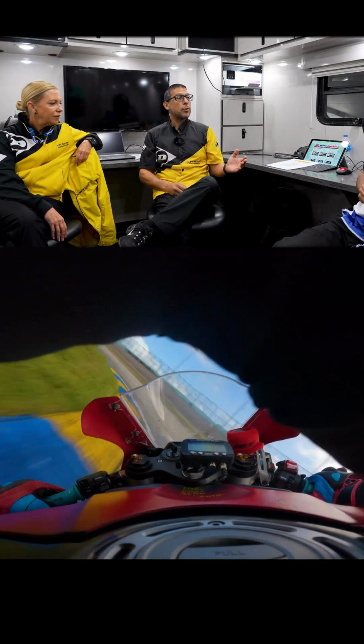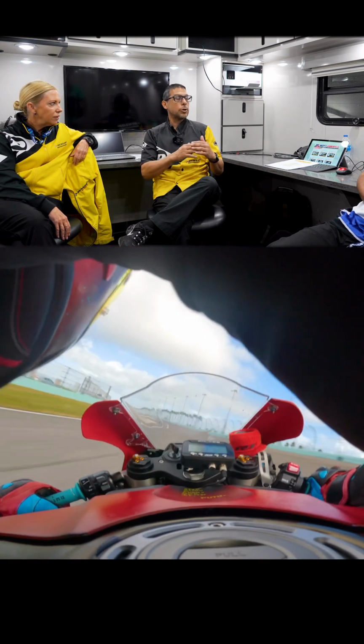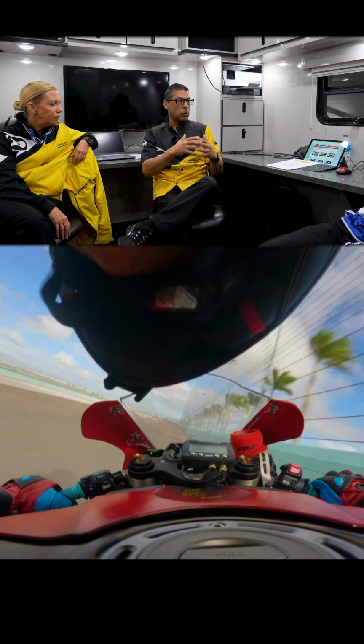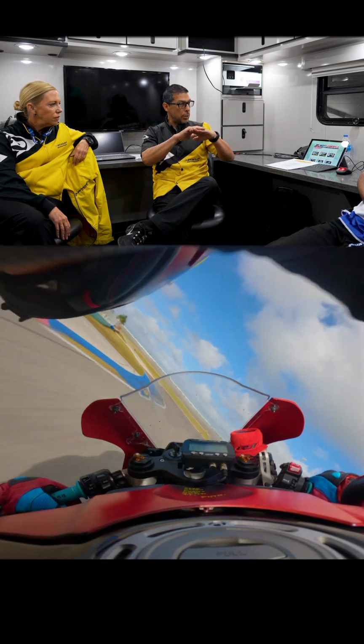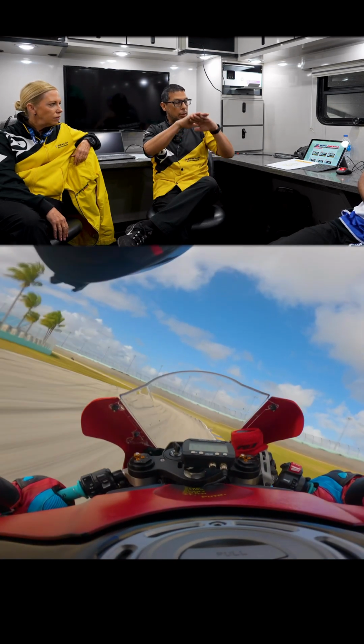Okay, so right there, you're already at a disadvantage. Once the tire has a heat cycle on it, it's going to cold tear easier the next time. So really you need to move up in compound. When it's cold, you want to be in the 7s or 8s. The reason that happens is the top of the tire is getting all this heat because you're trying to spin it, trying to get some grip, and the carcass gets cold.